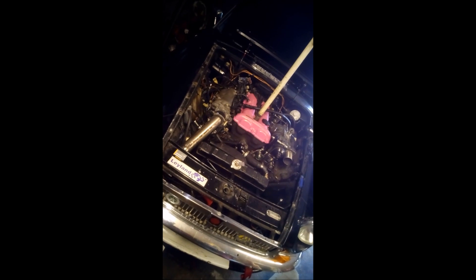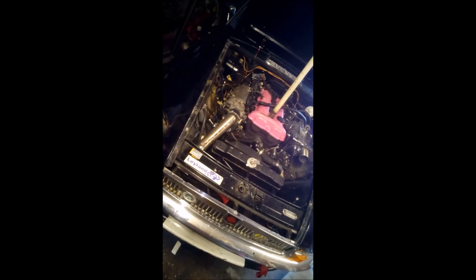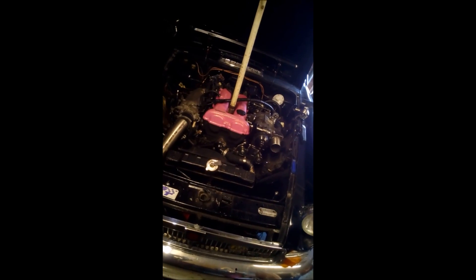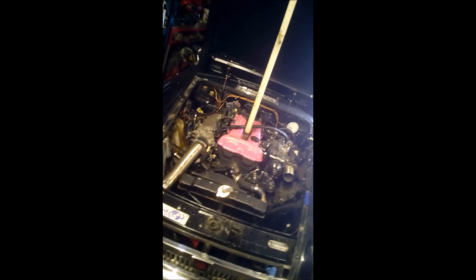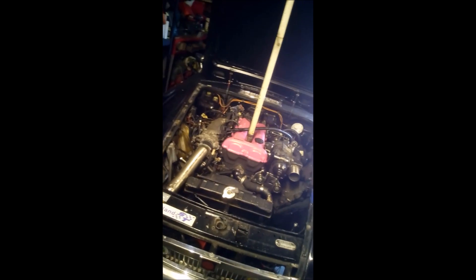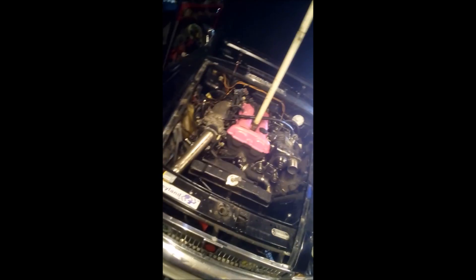So basically what we've got is a Mercedes C-class Eaton charger — it's just the same as the Eaton M45 that most MX5 owners bolt onto the side of their cars, except it's mounted differently and the outlet is a little bit different to what comes off a Mini. I've decided to copy a certain pulley system I found online that people were selling for 200-odd quid, but I'm cheap so I made it myself. It runs and drives, boosting about two PSI, and you notice it kick in.